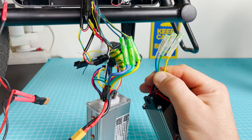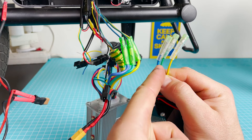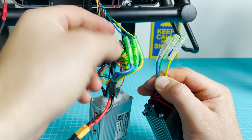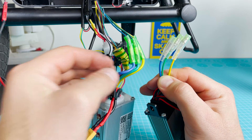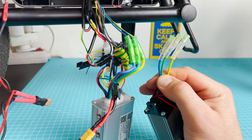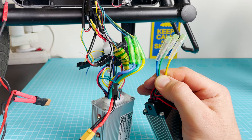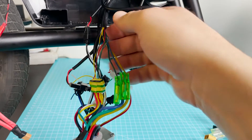Next are the motor main phase wires. On the original controller they were blue, green, and yellow — and on the bike side they were matching blue, green, and yellow as well. On the aftermarket controller I just connected blue, green, and yellow in the same way and that worked. If your motor spins in the opposite direction, you may need to swap two wires. Alternatively, this controller has a green intelligent phase recognition wire that will automatically sort it out.